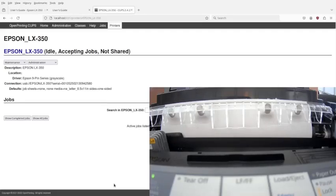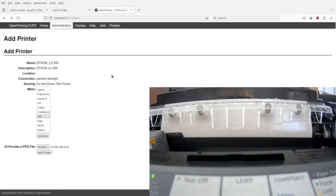We were able to switch it to the IBM Pro Printer mode and showed that the EPSON driver doesn't work over USB for that. But if we go to the parallel port, we were able to send it EPSON and IBM Pro Printer commands and get that to work. We could probably set it up over the serial port as well, though that would be a little more involved because that's not really a standard printer setup for a modern computer at all. I mean, parallel ports are basically ancient history, but at least they were very prevalent for a long time.